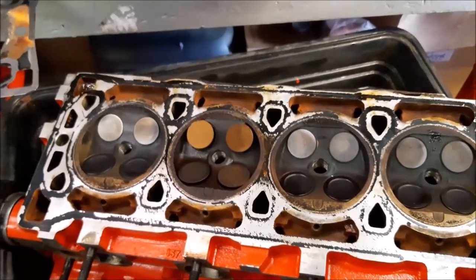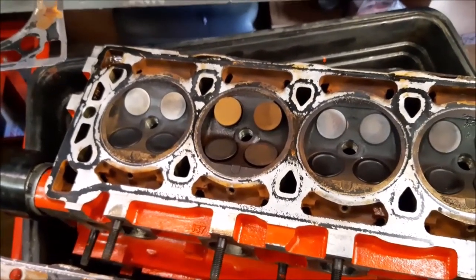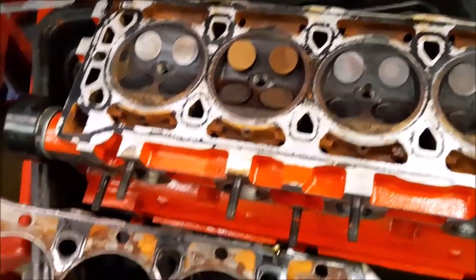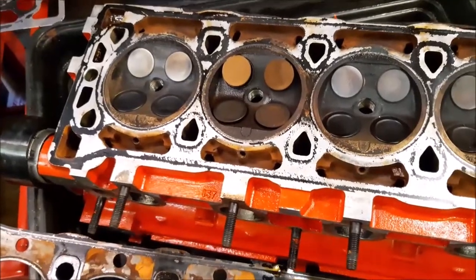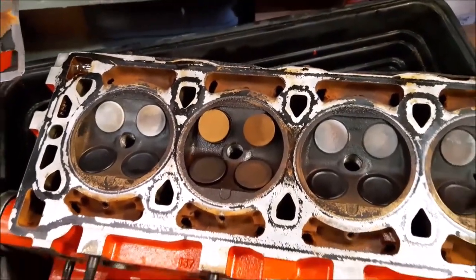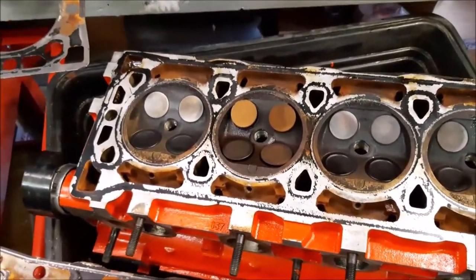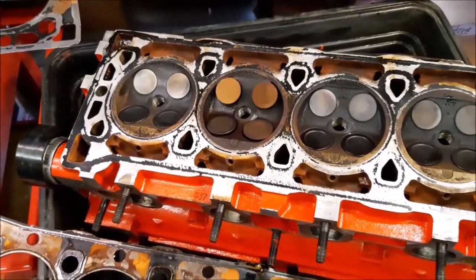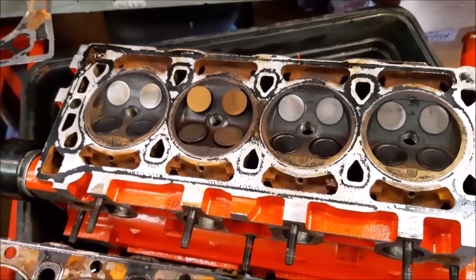As I was saying before, when I was talking about it, the other two head gaskets we did, and one of them there was oil in the water, so it had clearly gone. But when you actually took the gasket off and looked at the head, there was very little signs that the head gasket had gone, although it had. So it is nice on this one, we can see a clear difference. So we're going to clean that up, exactly how we clean the top of the engine up, and then I'll let you have a look when we've done that, and perhaps a few little shots of the process as well.